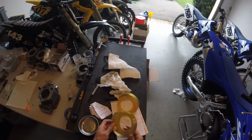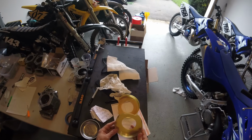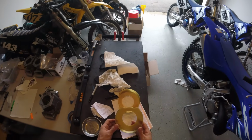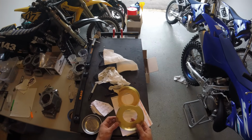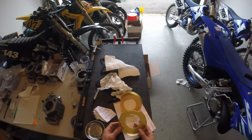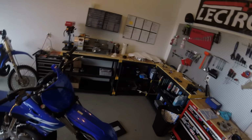They're made of a very gasoline resistant plastic called Ultem. It's kind of expensive, and it's also hard to print, so I had to outsource these. My printer couldn't do them, but they hopefully will work well and not dissolve and cause problems. But this is the most gasoline resistant 3D printable plastic available. So these will go in the cases.